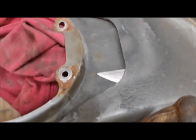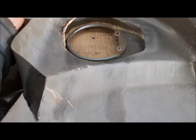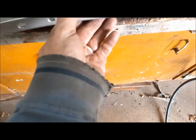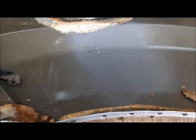Now I get this old bread knife and we just work in here between the two layers and get that sealer separated, and this thing should come right off. All the spot welds across here are popped - nothing attached there. I've got it freed from around the gas door. Now I'm dealing with all the sealer that's down and around here. You can't force it because you'll end up distorting the actual skin, and we don't want to do that. So we'll just keep patiently working it back and forth, and I might be able now to reach down in there with my knife and cut some of it. Now we can start getting this cleaned up.